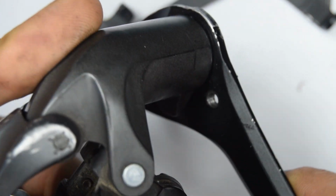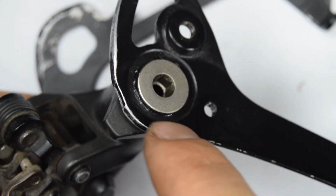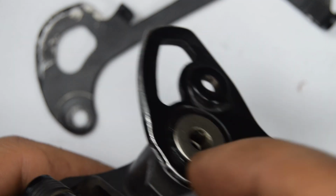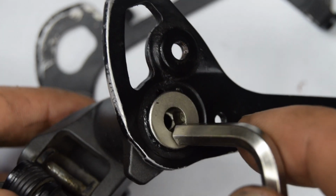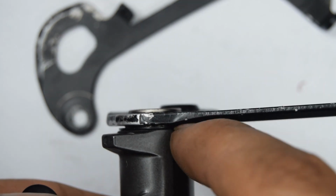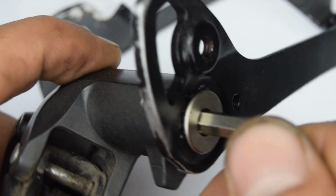Once I've done that, you can turn around. Here you have number 5. Unfortunately, these develop quite a bit of play. I think it's because it's grinding into the metal, or some part inside here is grinding into the metal, and then this part here has a play. You can't really rectify that unless you put a ring maybe behind this very thin one.